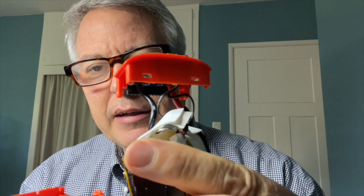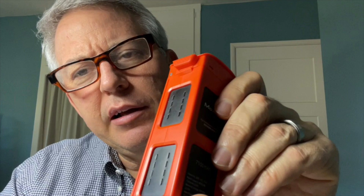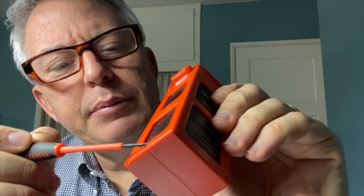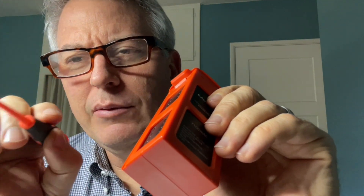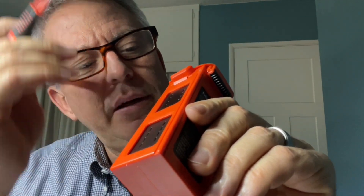When you get the top off, you'll be left with a case. You'll be able to pry out where those indent holes are and pop the top off — that's where the next challenge comes in. Looking carefully at this battery, along the side there's a seam running down the middle of each side. There's really not much room to get something in to pry, and I'm using pretty fine-tipped tools here.